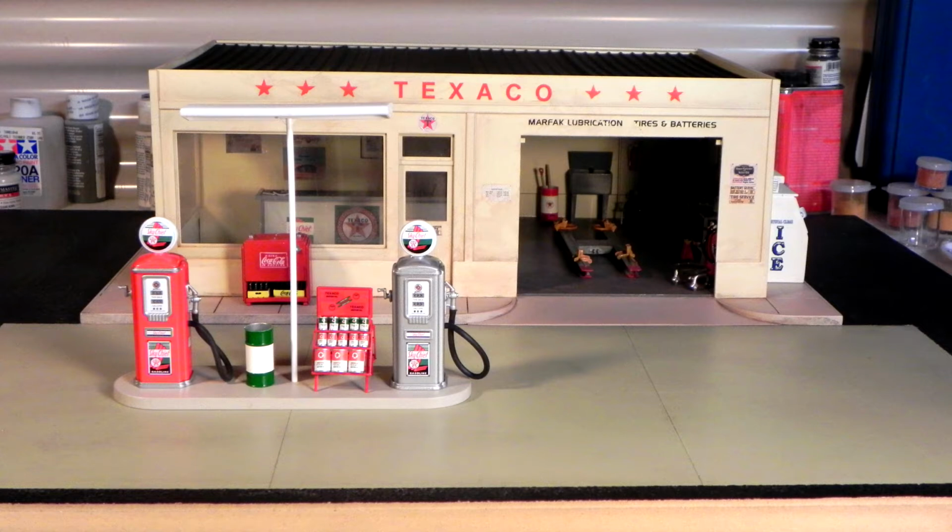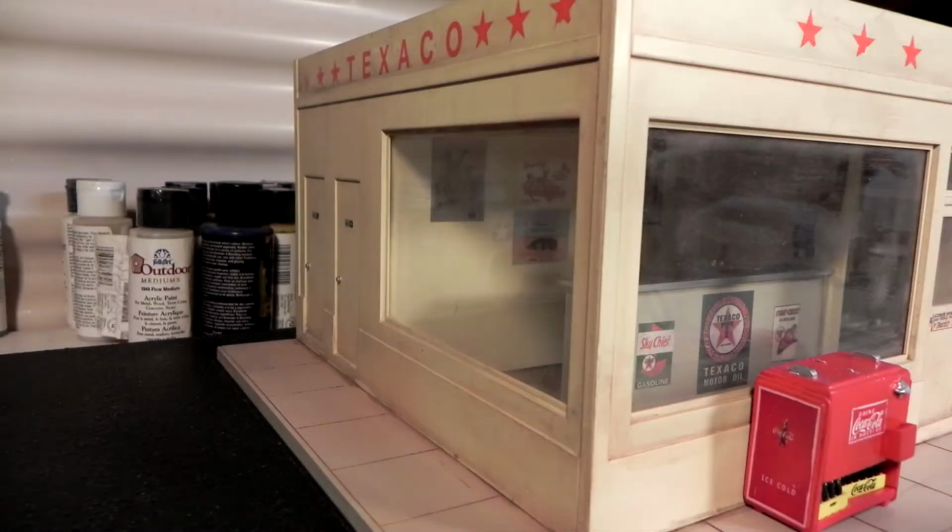Rule number 1 is that most dirt and debris that ends up in your paint comes from you. It's primarily a product of what you're doing. If the ground is not damp, or if you have crap on your clothes, like I wore the same sweatshirt that I sanded with, that I painted with on the 66, and it came out, well, you guys saw it. It wasn't too pretty, but anyway, I appreciate the help.